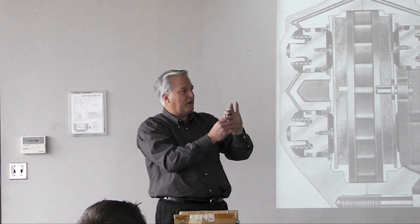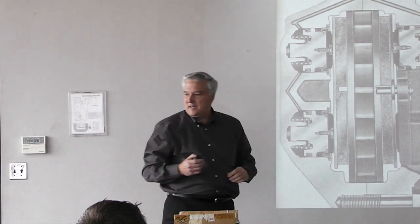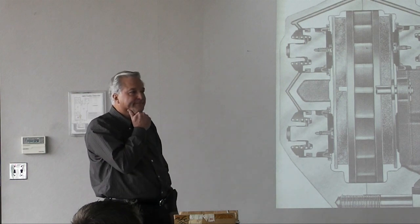The J56 piston has a big, heavy insulator on the front; the rest of the caliper internally was the same. When your brake pad started to wear more, the piston had to move more, and then you had more corrosion — and it was faster.